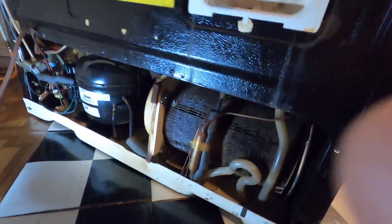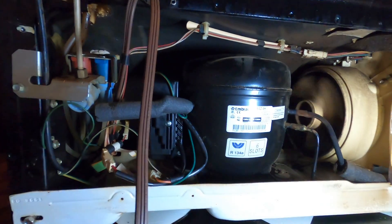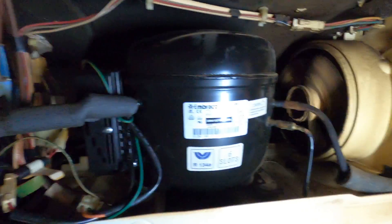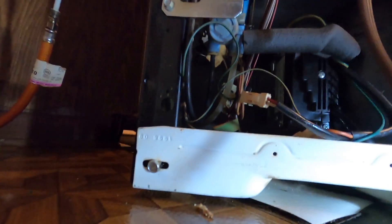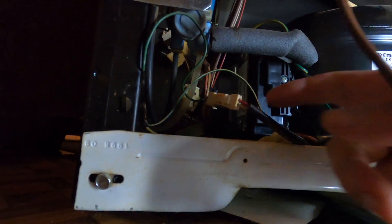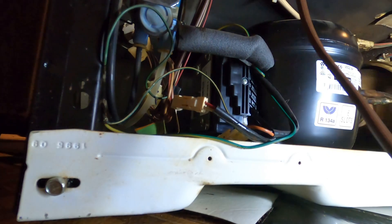Bearded Appliance Repair — we're gonna help you fix it. We've got a side-by-side GE refrigerator today, probably about 10 to 12 years old. We've got a no-cool situation and the compressor is not powering up. This video specifically is about the inverter on these GE refrigerators — if that condenser fan is running, your compressor should be running.